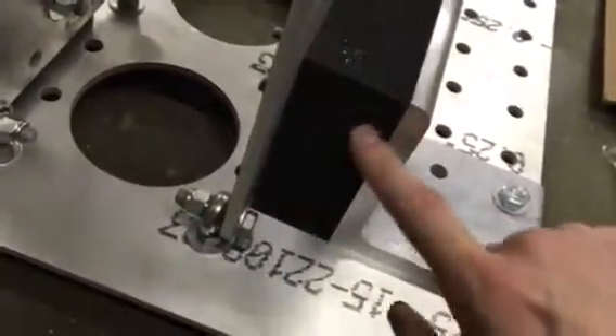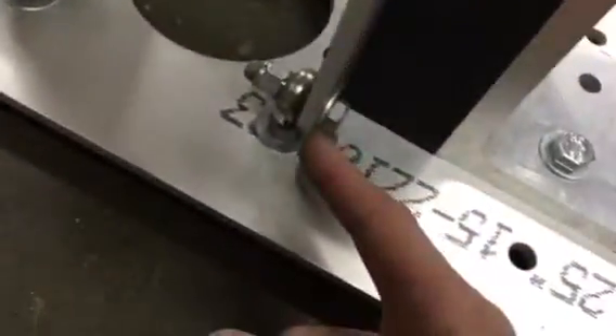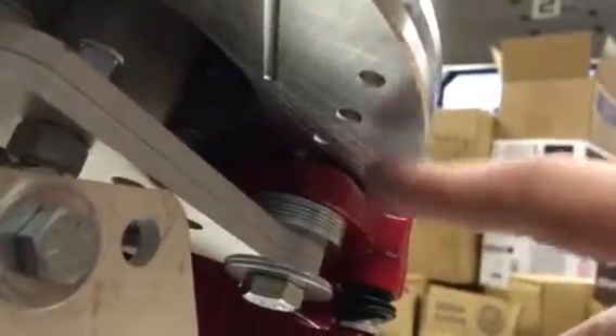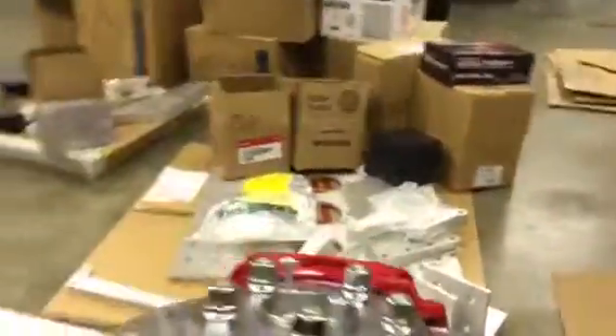The stud is going into the plate, not into the A-arm, so you can assemble it this way — it fits the bushings we've sent you. Washers on each side. For this bolt length, we only fit a washer on one side; that works fine. With the spherical rod end bearings, notice washer, washer wherever you can fit it — it'll spread the load. Before bolting onto your knuckle, we need to shim the calipers to the correct distance to center the brake rotor.